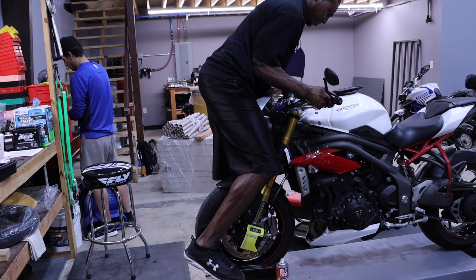We got the bike, I looked at it, did a little bit of a feel test. The feel wasn't too bad but the tire wear definitely was bad. It had a cold tear. Along with the cold tear there were oscillations of the tire being overstressed, which is a suspension issue.